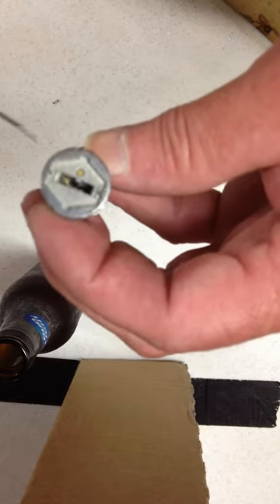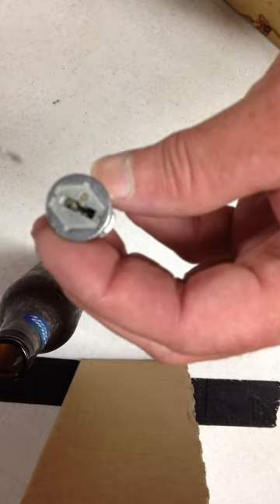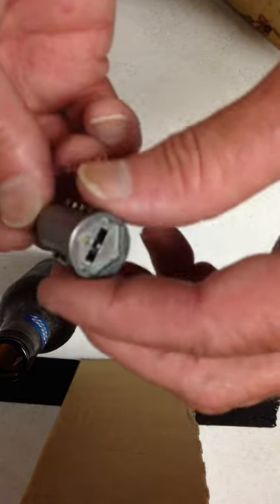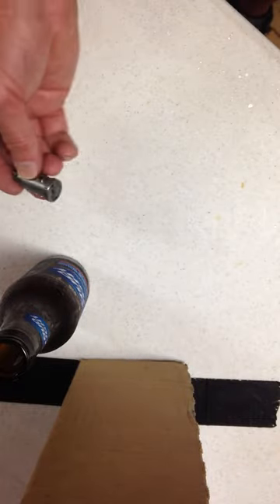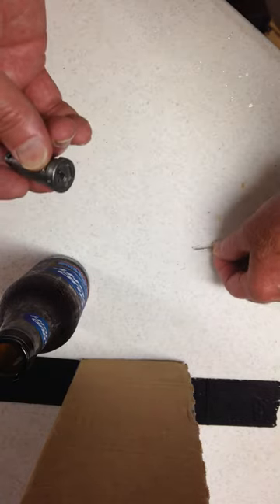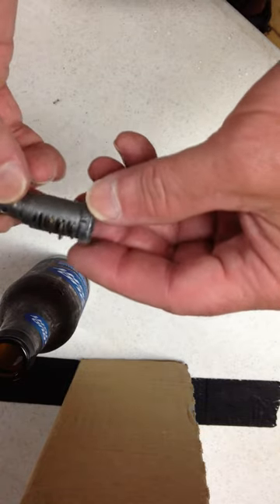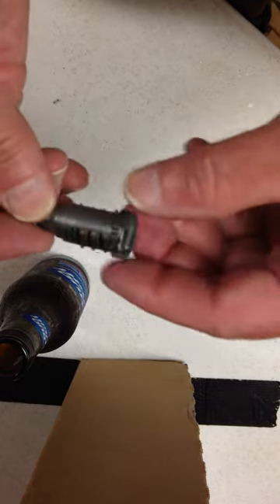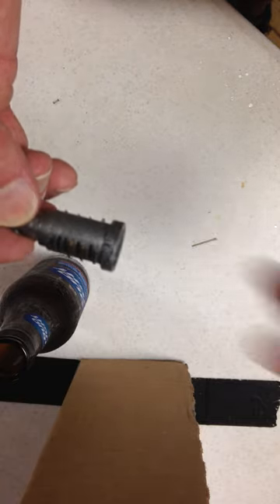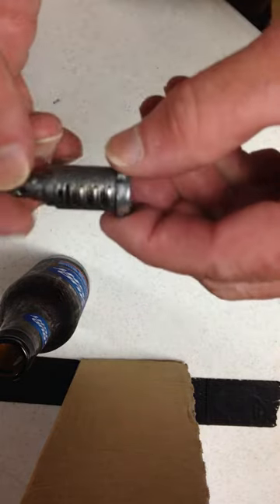The reason I think that pin is in there is that BMW wants to sell more replacement locks, so you can't just go and change luggage from one bike to another. They want you to go and buy this thing for $35 or $40 — I'm sure their spare parts business is probably the most profitable part of their business. In order to get that pin out, sit it down and give it a little gentle tap, and you can see it just falls right out. Once that pin falls out, all of these tumblers are now free to move around. So that's the difference between a replacement cylinder and a factory keyed cylinder — it has that little locking pin to keep the tumblers in place.